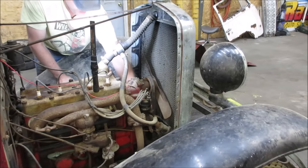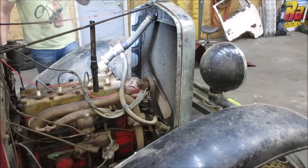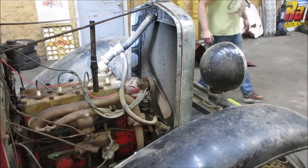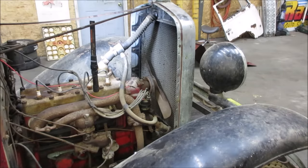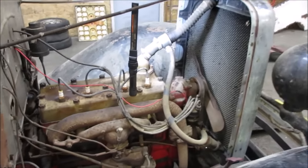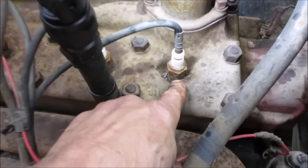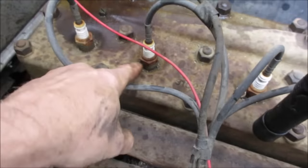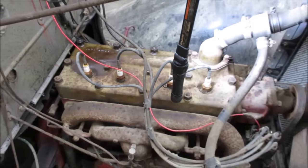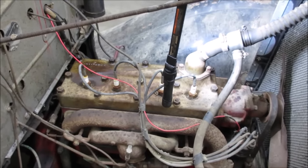It doesn't have a nut on the front of the crank. It's got a dog for like a hand crank. Let's get the plugs out of it. Throw some oil down. It's definitely not gonna hurt it. We're probably going to have to take some compressed air and blow the crap out that's around the plugs. And we'll see if we can get them out of there, and hopefully get a peek of what's going on inside.